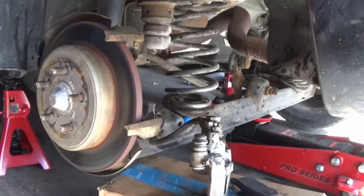We're going out for a quick little spin. The brakes feel perfectly fine, and when I hit them the car slows right down - they don't feel mushy, so I think we're good to go. I'm going to keep a close eye on everything and check the torque after driving for a little bit. It smells terrible and it's smoking. I'm hoping maybe some brake fluid accidentally leaked onto something, so I'm going to check for leaks and douse everything with brake cleaner when it cools down.